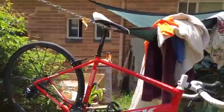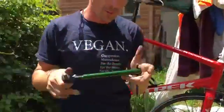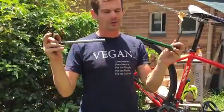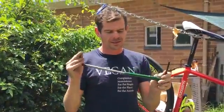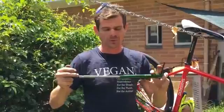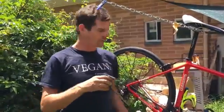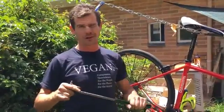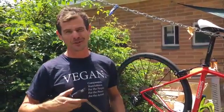Make sure your derailleur hanger is straight as well. This is my favorite derailleur hanger tool — it's worth about $500 in Australia — it's an Abbey Hanger Alignment Gauge. You don't know what good shifting is until you've used one of these. And definitely 34 in the front, 32 in the back — we're climbing all day. Alberto Contador ran 34/32 with some serious cadence and serious gearing.